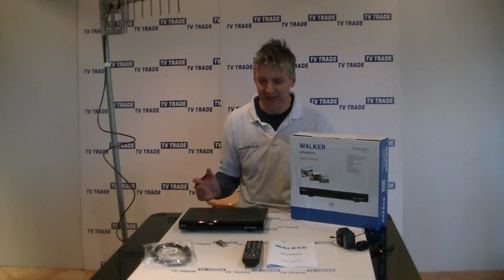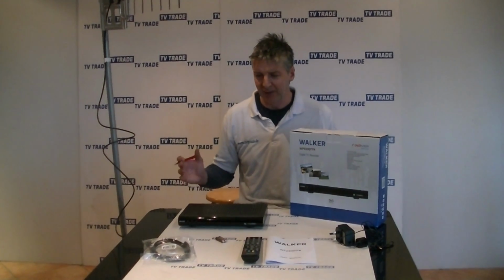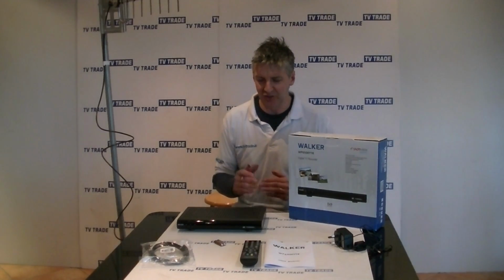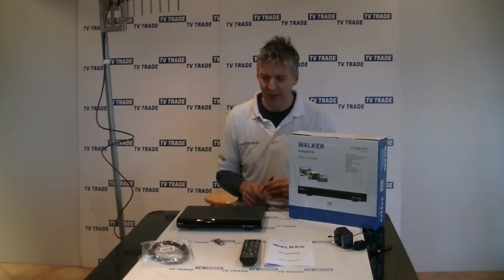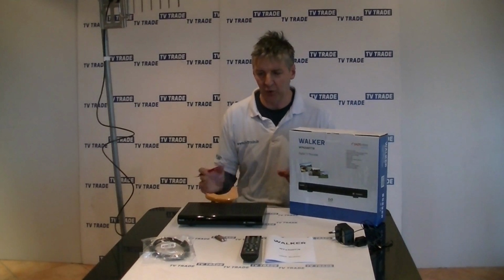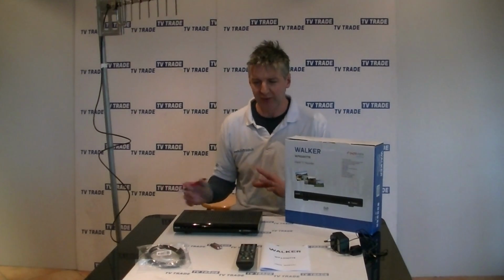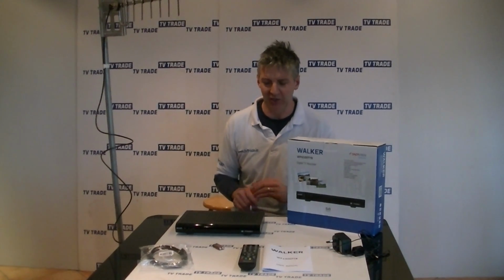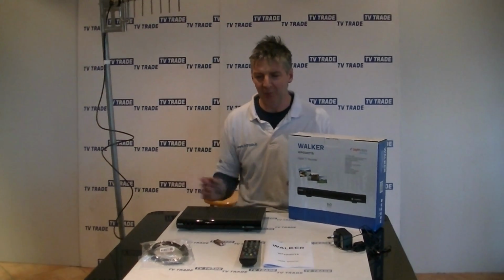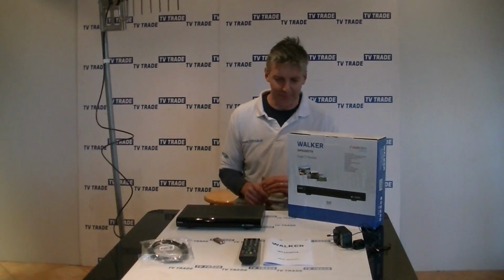The first thing is that it meets the new higher Saorview standards that require that instead of having just a T tuner, it has a T2 tuner, and also has a built-in hard drive. It is a twin tuner, so it means you can record two different channels at the one time. Also, it's worth noting that in the North, Freeview HD uses T2, so it'll make it more compatible with the latest technology being used on Freeview as well.